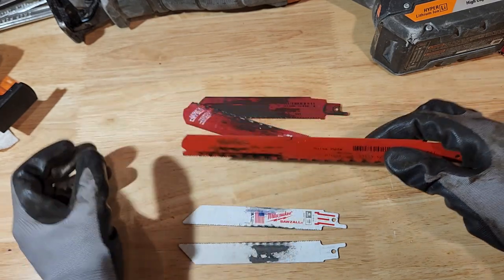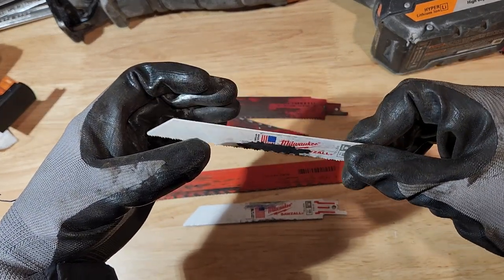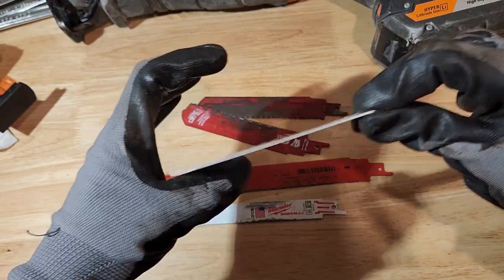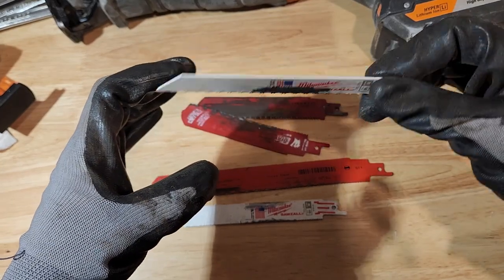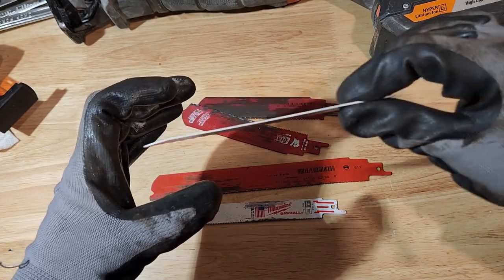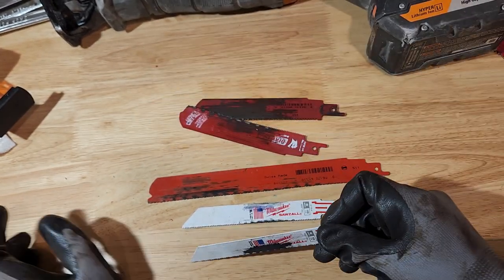You really want to use the shortest blade possible, and that will give you much better control to just cut through the bushing or the bolt without risking banging into the sheet metal, which you don't really want to do too often, because you'll end up damaging the blade. Also, it can be way harder to control a long blade with the stroke, trying to keep it off the edge from banging into the sheet metal. So buy just long enough that you need, not too long.